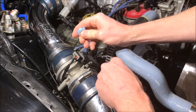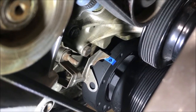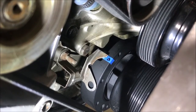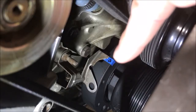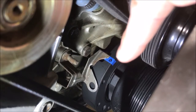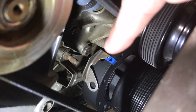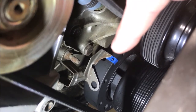At this point we need to reference our balancer. Now that we've located the compression stroke on number one, we need to bring the balancer to zero degrees — that will be top dead center on cylinder number one. You can't really see the degree marks on this balancer, so I've put blue tape with a marker mark as a stand-in for zero. You basically want to line up your timing marker with the zero degree mark on your balancer to get to top dead center. If that didn't fully answer your question, please see my other video.